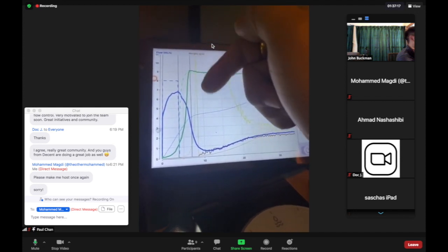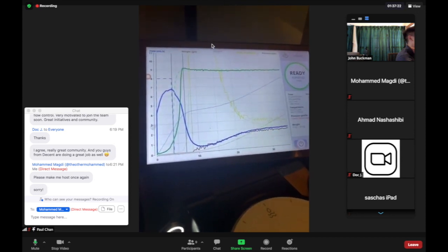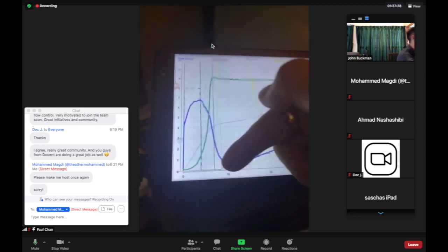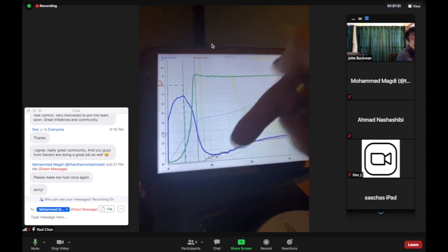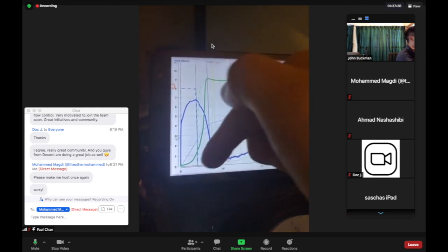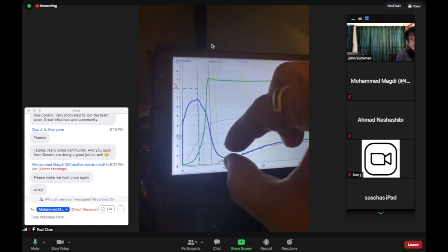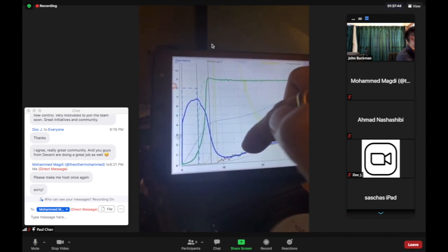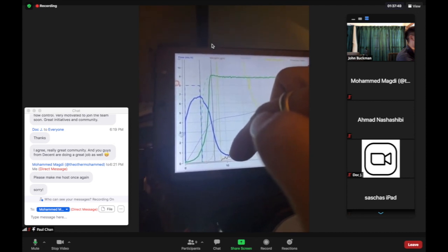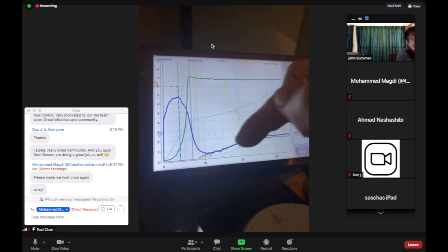Now, if that sounds true and the dry spots are reducing the holes, therefore you have a higher pressure inside your group head. This would sort of explain why you're having drips at certain points while it's going around, but it's not a constant flow. If we had a constant flow, we would find that the milliliters per second would rise very quickly and become where we want it, much similar to the reference shot we use, where it did dip below 1, but only very slightly, before it rose off and gave you the expected curve.